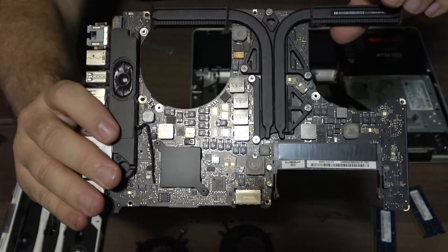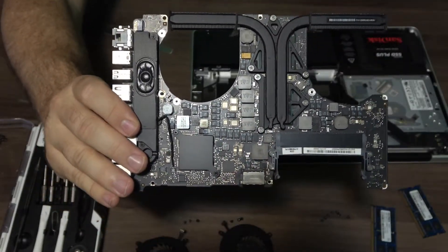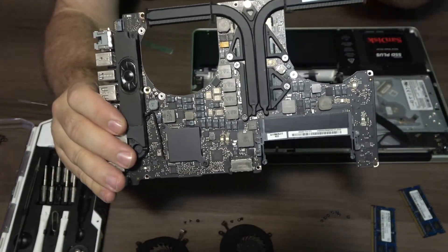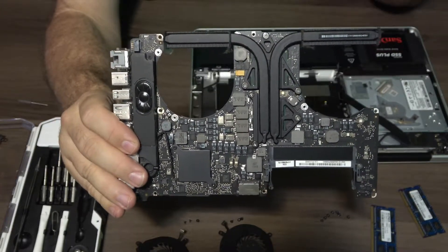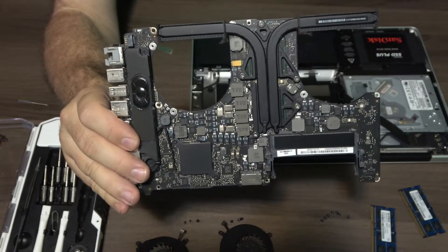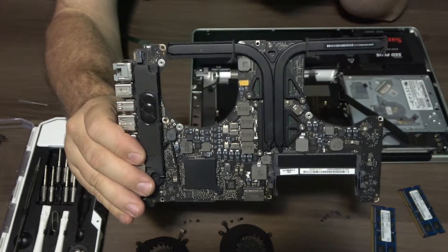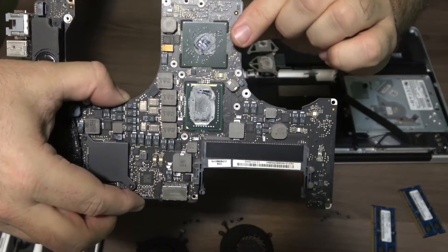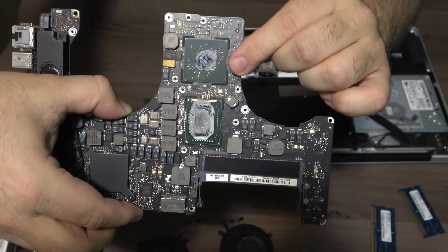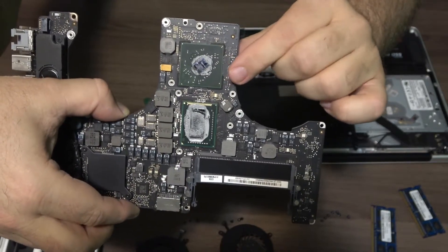I've done a lot of Apple repairs and every single one of them is just an overheating issue. It could be user error — using it on a bed with the back vents blocked is sure to kill your video card. But it also comes down to the design. They built these things to be laid on a table and that's how they're tested, but that's not the real world — and in the real world this is not exactly a good cooling system. This here is your GPU and this is your CPU. The GPU at the furthest back is our culprit. I'm going to do a video reflow on it and fire it back up with new compound, hopefully getting it back up and running.